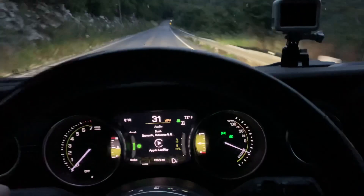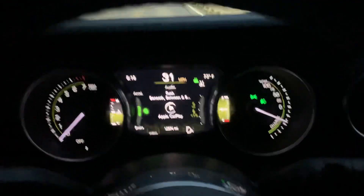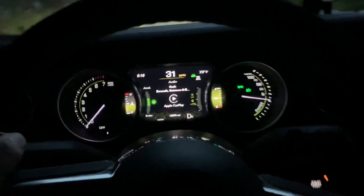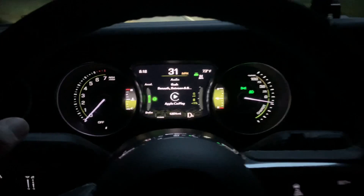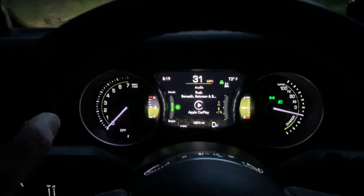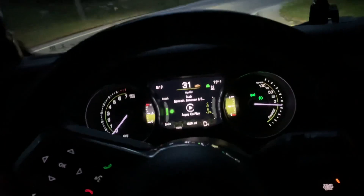Here's a great example of using adaptive cruise control instead of max regen. If you set your adaptive cruise control to whatever speed you want the vehicle to hold at while going down a big, long hill, it'll hold it at that, whereas max regen may either be too much deceleration or not enough to control your speed. And when you're going down the side of a hill, not only will it hold you to the speed, but if you catch up with somebody, they will be riding their brakes and you will be generating power while riding down the side of a big mountain road. Just another tool in the Wrangler 4xe arsenal.